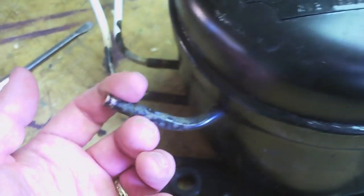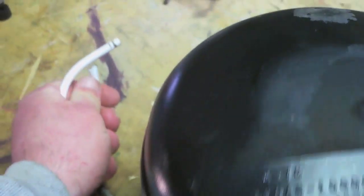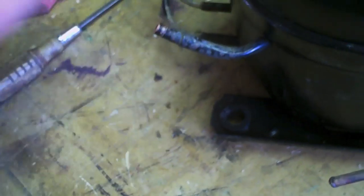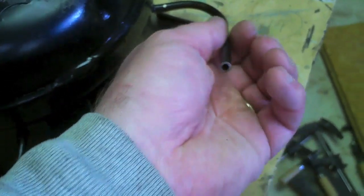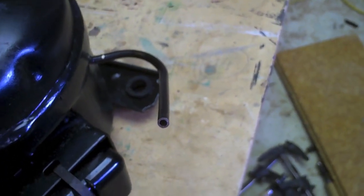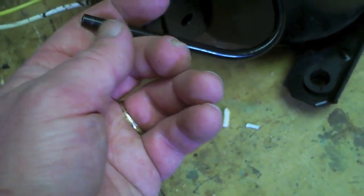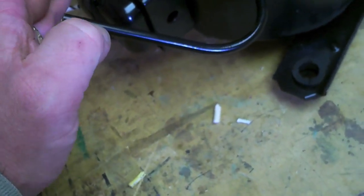Another nice thing that you can do with these things is you can turn them into vacuum pumps. Now, in this case, on this compressor, the larger line is the vacuum line. From what I understand, usually that's the other way around. These two lines, you don't use them. You can just ignore them. That has to be the vacuum line. What I'm going to do is put a piece of hose and an old fuel filter on here just so that it doesn't suck a whole lot of funk in there, and this is my high-pressure steel line. I expected that line to be copper, not steel.